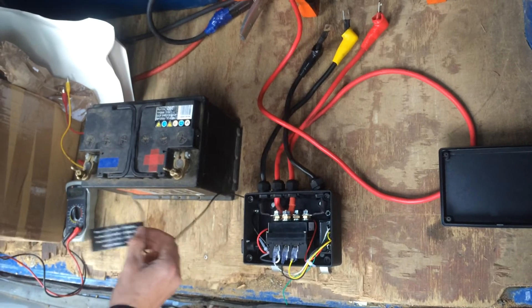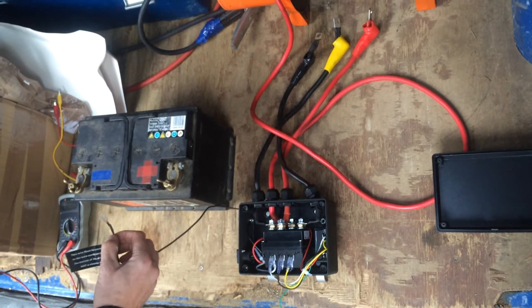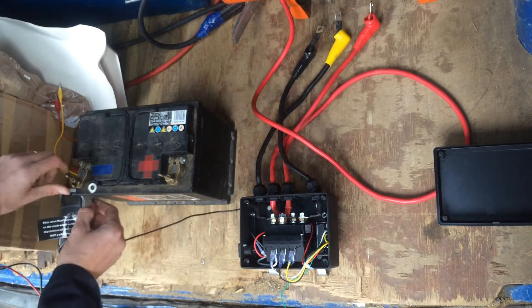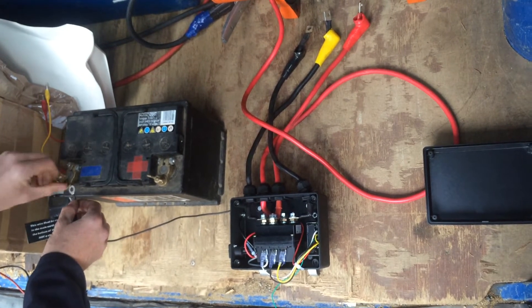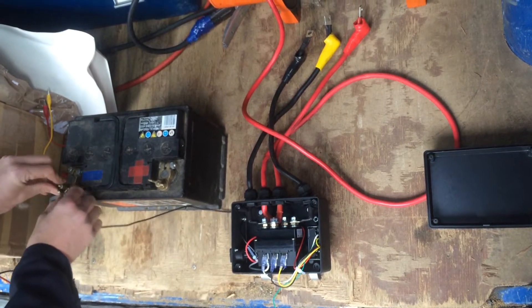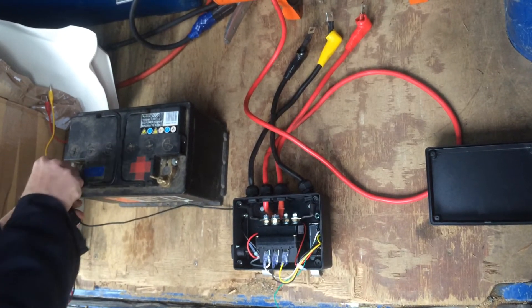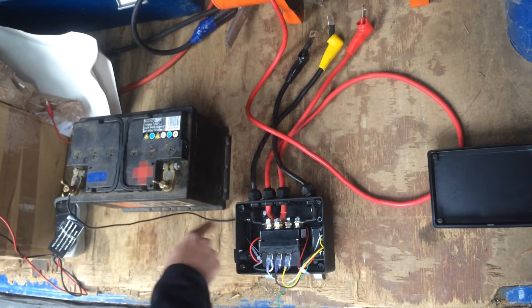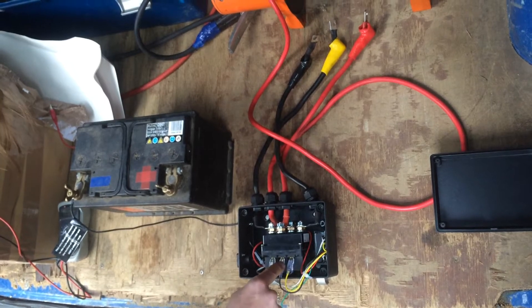This black lead must not be connected to a chassis — it's vitally important that it's connected to a battery earth, which is normally on the bottom terminal of the winch motor. For the purpose of this, we're going to put it straight onto the battery so we know we've got a good and direct connection. That goes from the battery through the side casing; there's a nut and bolt in there and it routes to that centre terminal.